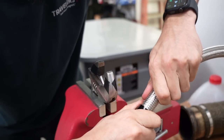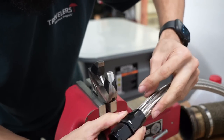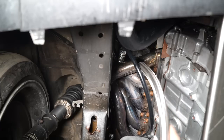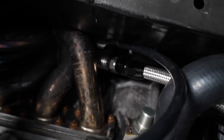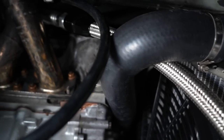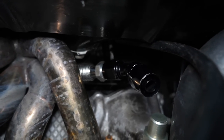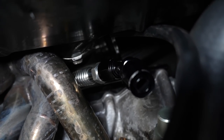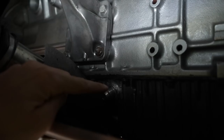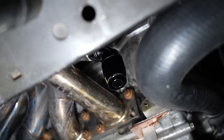Because that nub goes in and expands the hose into the fitting — good thing I mounted this in the vise because it's actually super hard to turn now. I'm tugging on it — yeah, that's good. It definitely would have been better if this were a 45. It looks like it would be best if I use a 45 off the flexible drain to go on the left side of the radiator. I went to a speed shop and got a 10AN 45 — it fits way better than the straight. Now the hose is going to drop straight behind the radiator hose and straight down into the oil pan fitting.